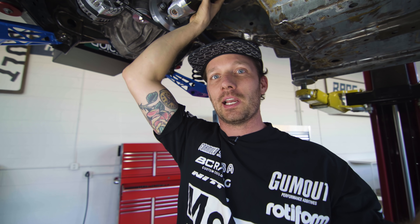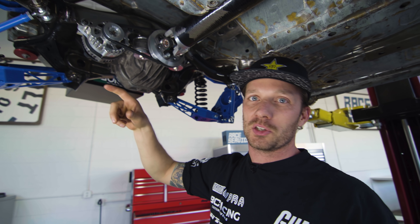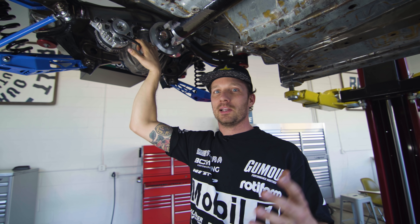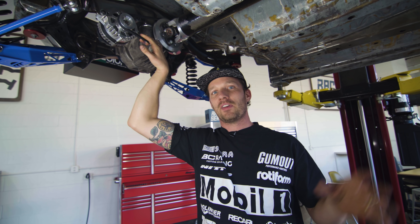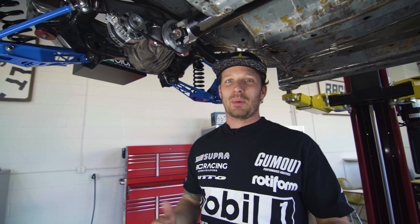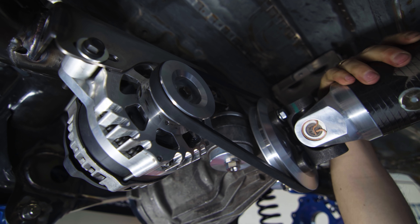The Judd does come with an alternator on the lower driver side of the engine, but it's only a 35 amp. So it's just enough to probably power the car to start it. After we start driving, we can flip a lot more of the switches on to power the rest of the car, because we're going to have running the fans, the headlights, the taillights, fuel pumps, et cetera — everything drawing a lot of amperage, and 35 amps is not going to cut it. That'll be just enough for us to fire the car up, maybe run one fan and a fuel pump. Basically, it's just going to be able to warm the car up and get it on track, and when we get it on track we'll turn the rest of the electronics on, powered by the DC Power 270 amp alternator.